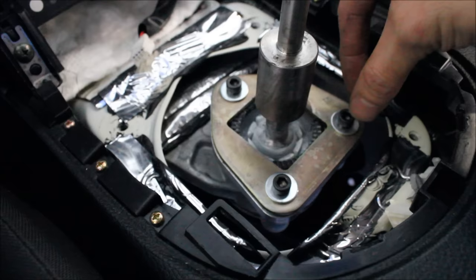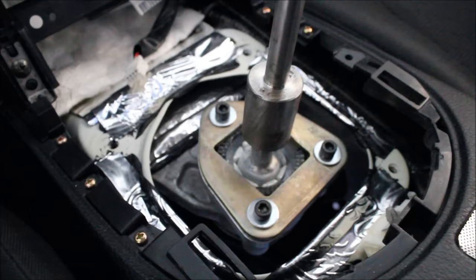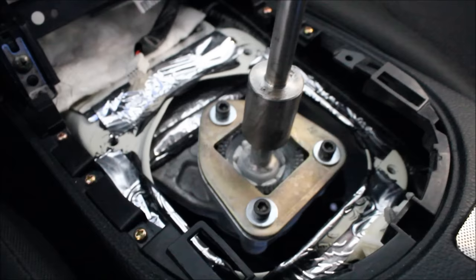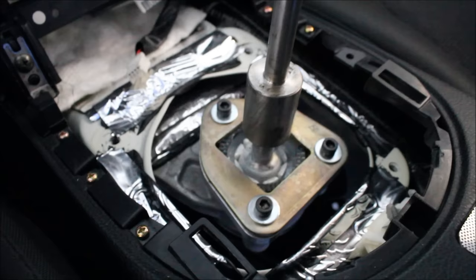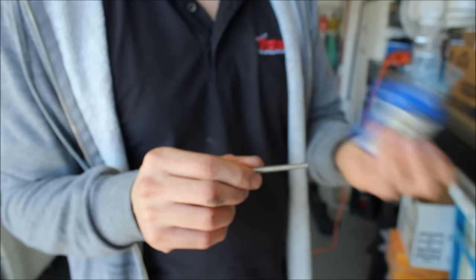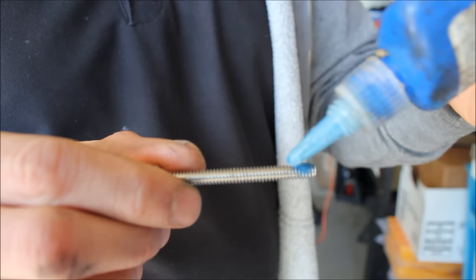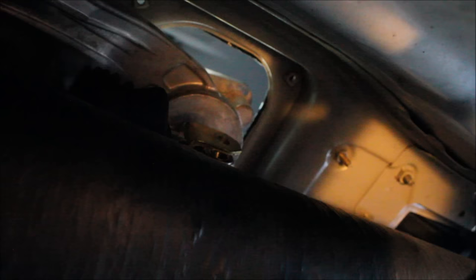I'm not cinching this down yet but I did put a little bit of thread lock blue on the threads — I'll show you how I apply that — because I never want this to back out on me. Just a little bit of thread lock blue on your threads is going to make sure this doesn't come out. When you're adding thread lock blue, if it's been sitting for a while make sure you shake it well and just add a little bit to the first few threads. As you tighten it up the thread lock blue will actually creep up, and then you still have some time for it to cure afterwards.